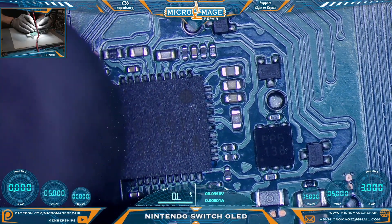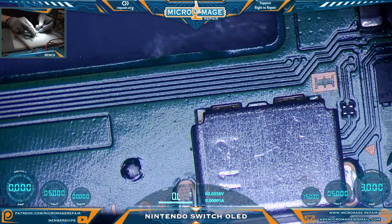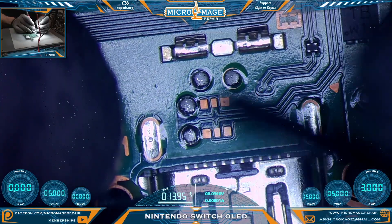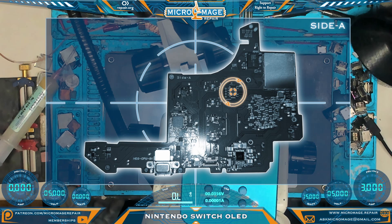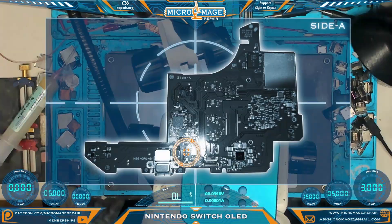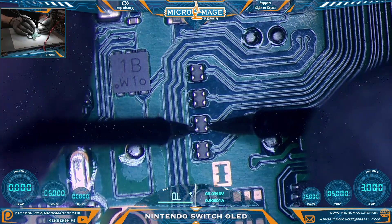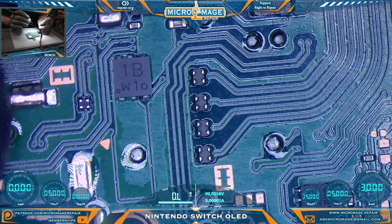We'll continue our testing — one shorted capacitor. Real quickly, we're going to lift this shield, because we found on the last one there are test pads under here we can use for testing as well. I'm going to check these two. And we are short — I've highlighted that for you. This particular test pad is definitely 100% connected to the M92T36. Let's move up the board to the Pi 3 USB area and take a look around. I'm just going to test this big capacitor up here — does not appear to be short, that is good. Now we're going to pop down here to this area and check the filters. I believe these are the filters that are very much like the original Switch — we do our normal testing, make sure they have continuity going through them but not side to side, and make sure they're not shorted to ground. Everything is looking good there. Excellent.